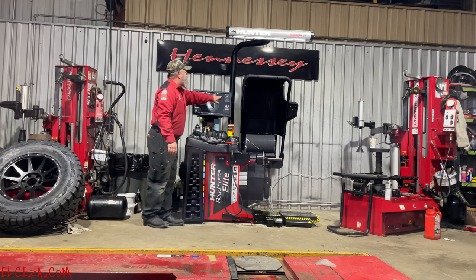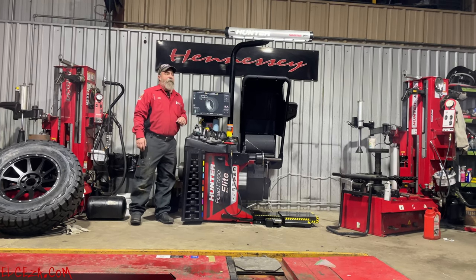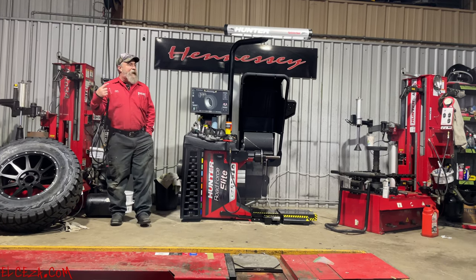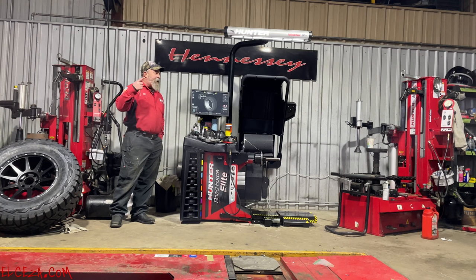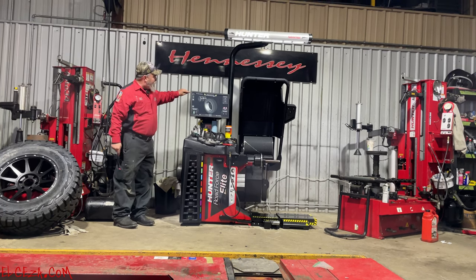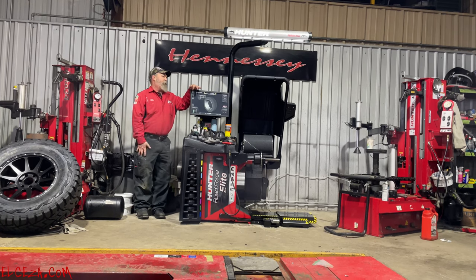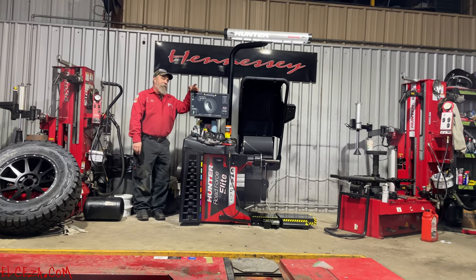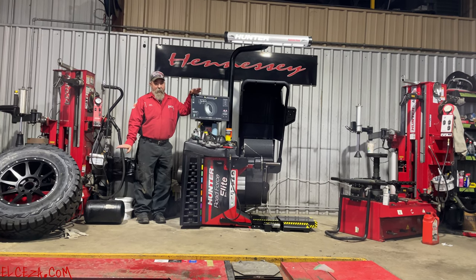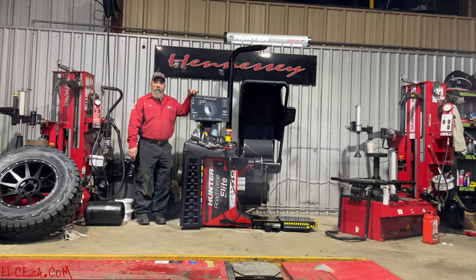Excuse me, you clear the tire stack with your tools, reset. Yes, the tire stack will be clear at that point. If you continue to balance tires, every fifth tire will be number one in the stack again. You'll get a red dot, a red overlay over this with an exclamation point in it. Guys, don't call me and say there's something wrong with the balancer. That just means somebody hasn't cleared the tires back. That's all that means. Okay. Tools, reset, yes. Clear that back out.